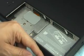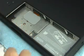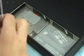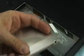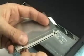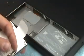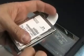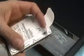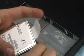I've just found one of the magnets that Apple uses to close the lid on the MacBook. You'll notice the screws are a Torx T8. These are a little bit more difficult to get in — they don't want to hold themselves into the head of the screwdriver very well. Insert the last screw.